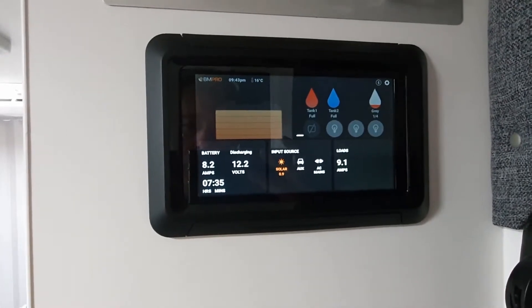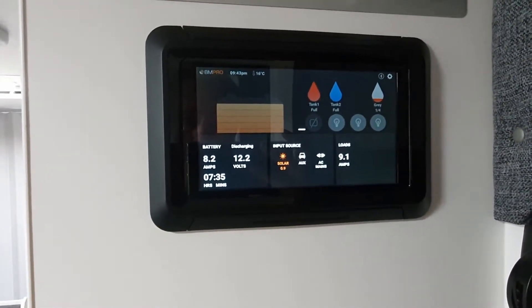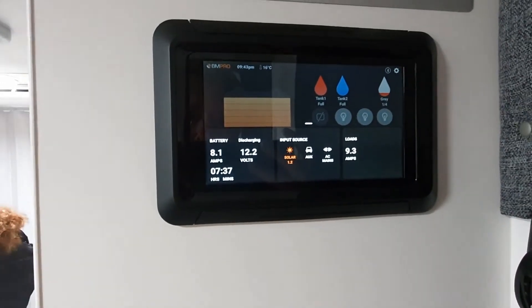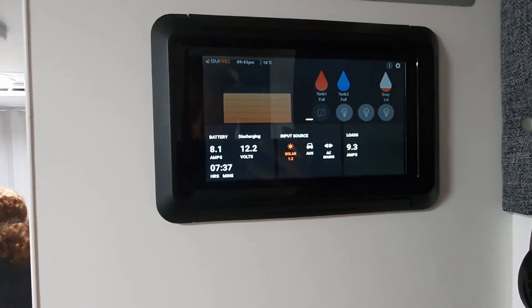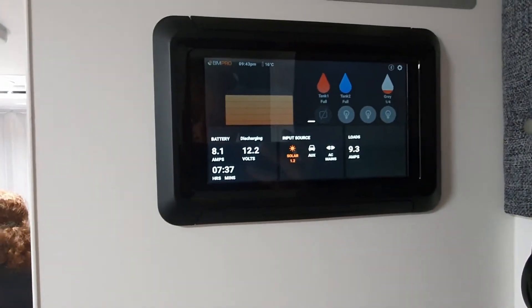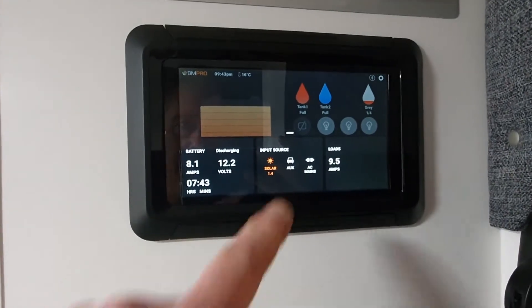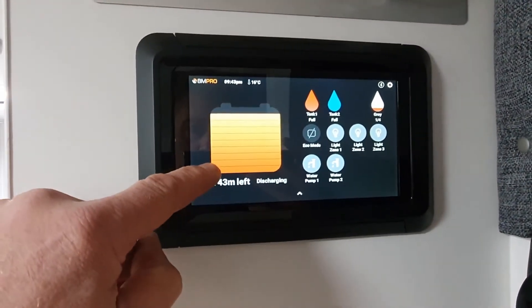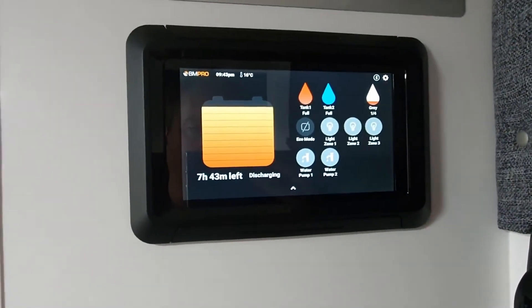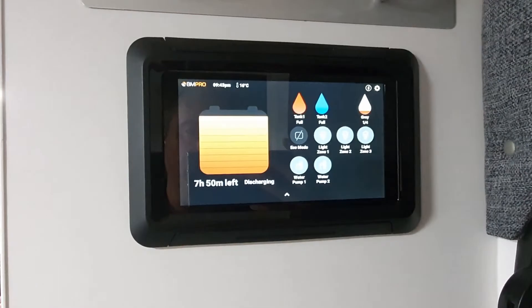So if they're going to do that, they need to install a product called a BC300 Comlink, and that enables them to take the information that that device is pulling from the battery — taking all the amps and the voltages — and sends that into the BP35, which then sends it up to the Odyssey. So our issue is where this would appear to be empty, but we've got volts left on the other side, and that's because we've had the battery drained by an external device.